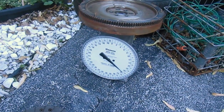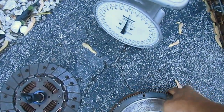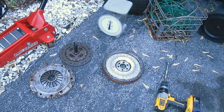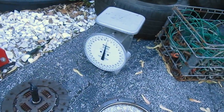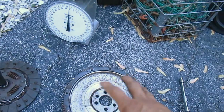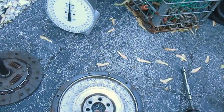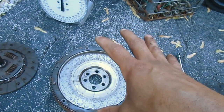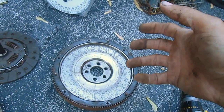Those flywheels cause a whole different issue at idle. The TDI will transfer some of that engine vibration directly through the clutch assembly to the driveshaft, because you don't have this heavy mass that via centrifugal force centers and balances it. That's why flywheels are always balanced — you always want to make sure your flywheel is balanced before you put it on the car. With ultralight flywheels, they don't have enough mass to balance the force coming from the engine.